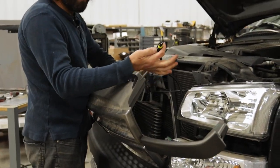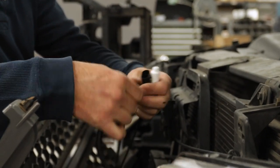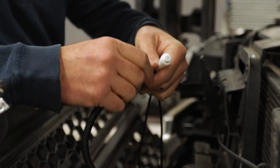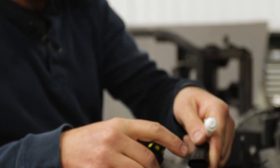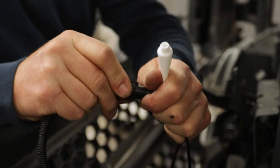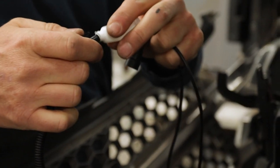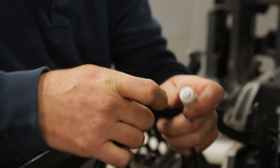Then you're ready to plug your bar in. On the white-only it's just a single two-wire plug. Plug it in so that the catch on the female plug lines up with the hook part of the male plug and it should clip into place. If you do have any dielectric grease left over, it's not a bad idea to just squish a little bit into that female plug — just a little extra precaution there.